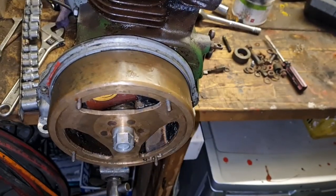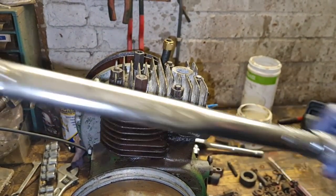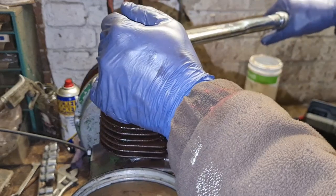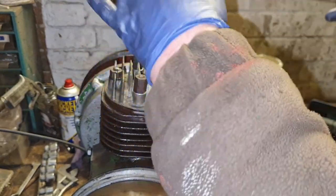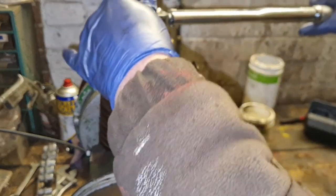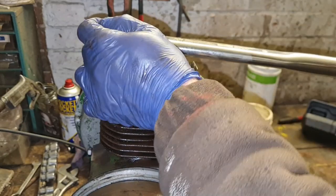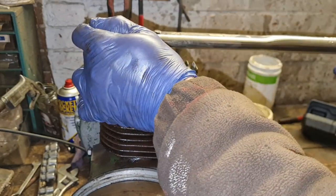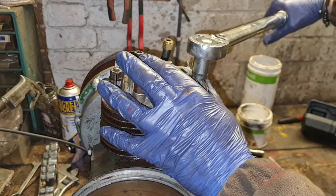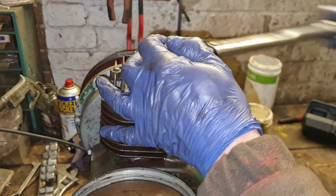Alright, I have nipped our engine back in our vise, so we can tighten these head bolts down with a torque wrench, come on. None more of my click click. We're going to do them in sequence till we really know they're all the same. So all we're concerned about is they're the same torque. There you go. This is about 30 foot-pound.